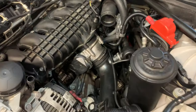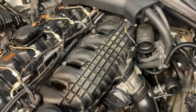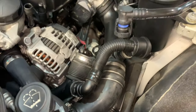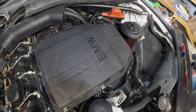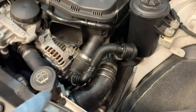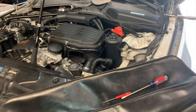Get your air box and pop it in — charge pipes first — then line up the rubber grommets. Make sure your diverter valves are plugged in and the tabs are turned and locked. Make sure all electrical connectors are connected and hose clamps are tightened. Once the charge pipes are lined up, tighten the hose clamps and make sure the intake box is seated in the rubber grommets. Reconnect the vacuum line, pop it back into its tab, put the intake duct back, reconnect the battery, then perform your coding and adaptations and you're good to go.